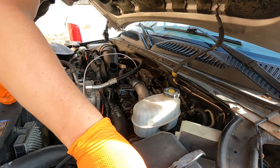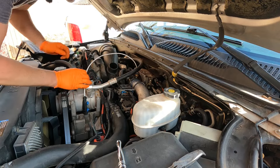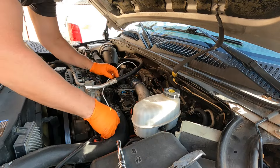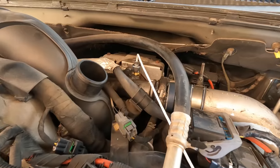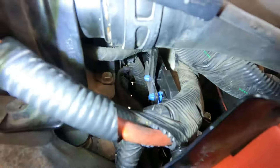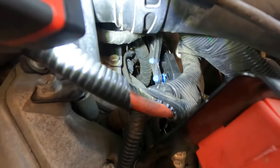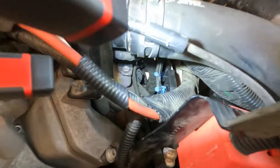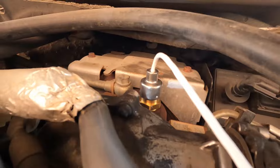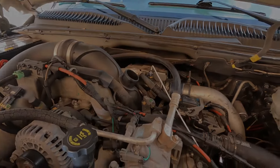That's it. Now it comes with a heat shield to wrap around it, so I'm going to get that and put it on. Then we're going to snake this cord down out of the way the way it kind of was, and plug it back in. Now we've got it plugged back in. You follow that white wire down to where it's attached to that bracket by those little blue tabs on the back of it — that's where the new one is plugged in. Now we're ready to put the heat shield on top of and around that sensor, and then put the air baffle back in place.